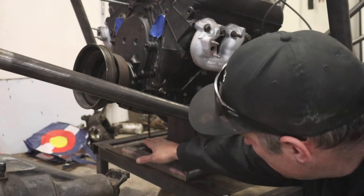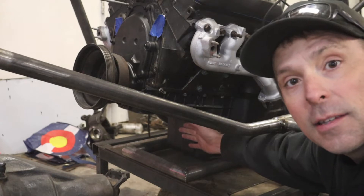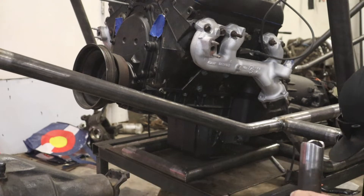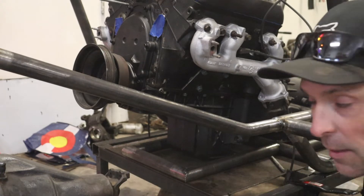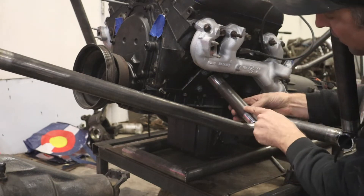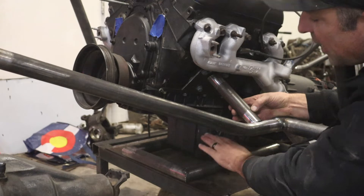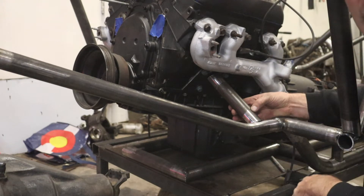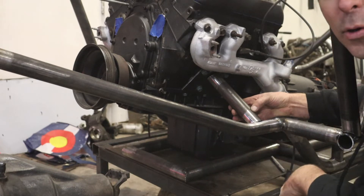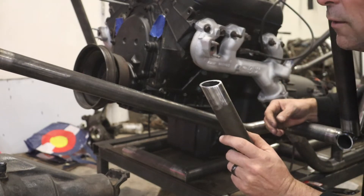I've got my skid plate — this is going to be the skid protector. There's going to be AR plate under this to protect the oil pan from rocks. I've cut a couple of pieces that are going to attach to the motor mount. I've got my motor mount on the engine, and then I've got this bar going from the chassis over, and then another tube coming down and tying into the skid plate. This is similar to my other rock crawler — it'll all triangulate and tie together to help support itself. The next thing I'm going to do is weld these in place.